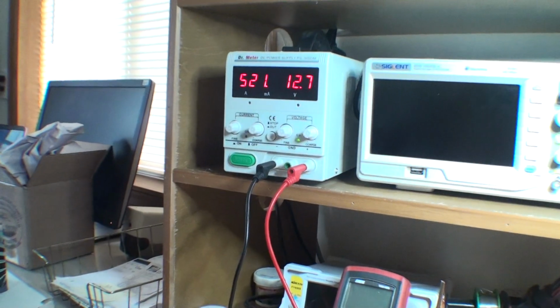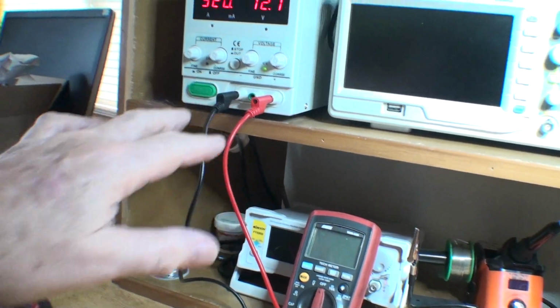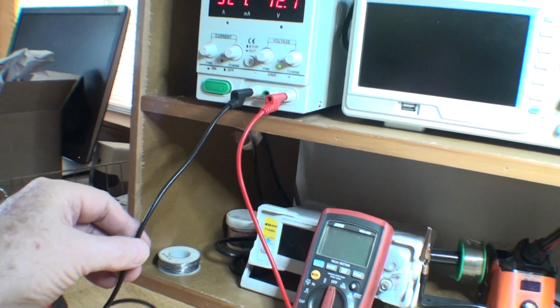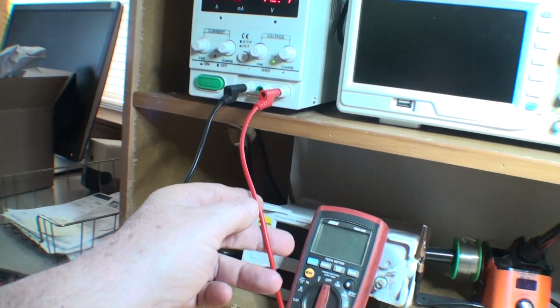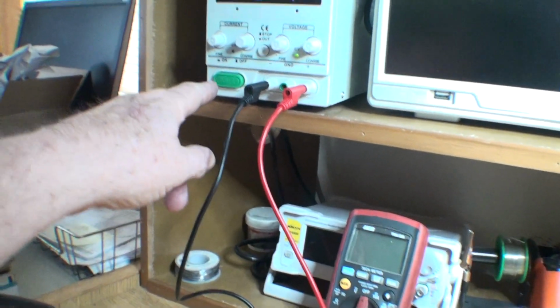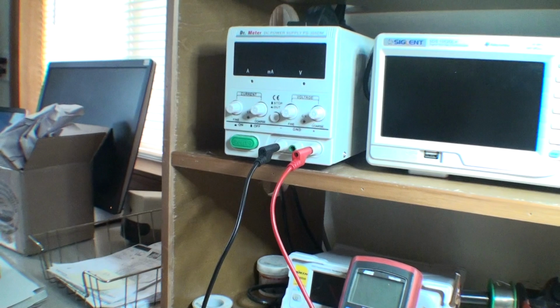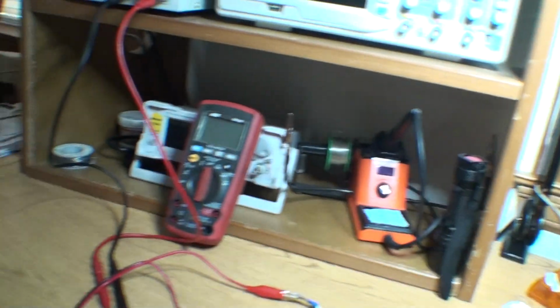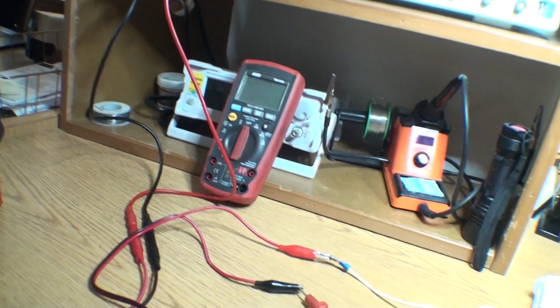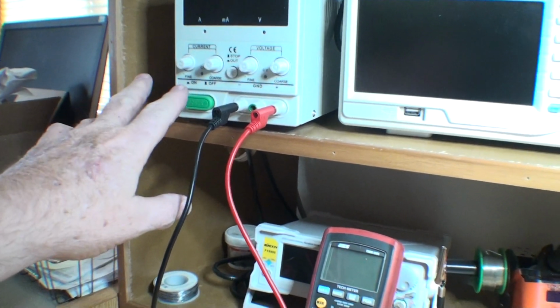Again, with the battery cable, you have two cables. One is going to the ground of the car. One is going to the key switch, or to all the fuses. So in this case, we're going from the key. Let me just turn this off. Let me go a little bit further before I do this. We really have no amp draw right now, so it's kind of representing a leak, and it's not. But anyway, turn the key on.